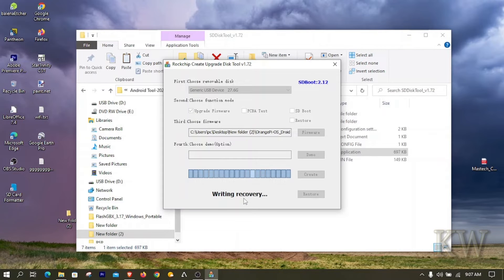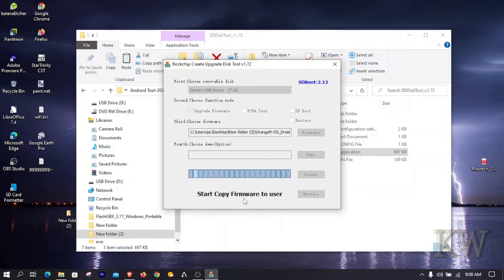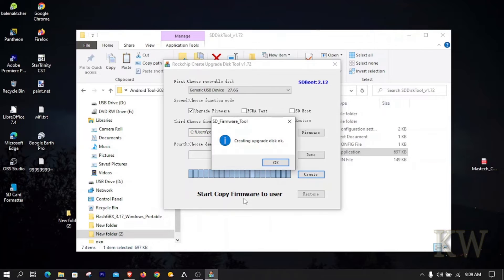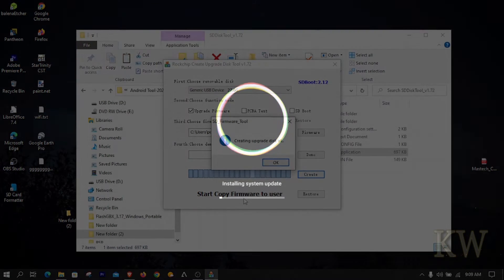Select your image, then write it — pretty easy, that's basically it. It takes maybe about five minutes depending on your card speed. Make sure you have a USB SD card reader or it just won't detect it, which is strange since you'd think it would detect an SD card in your laptop. I spent quite a bit of time figuring that out — tried different SD cards, no go. Also remember to change the config.ini language setting.